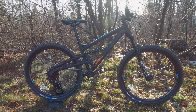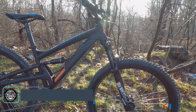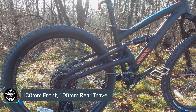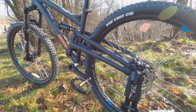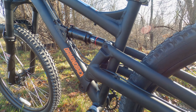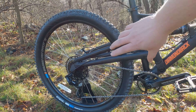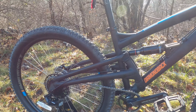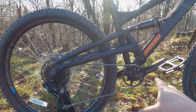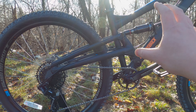How they achieve that on this bike is the ATROS frame is set up with 130 millimeters of travel up front, but it only runs 100 millimeters of travel in the rear. That four inches of suspension travel in the rear is done through a traditional high pivot, single pivot rear suspension, meaning the whole rear swing arm rotates on a single pivot. By having that pivot above and in front of the bottom bracket, this is going to have pretty decent climbing capability for an inexpensive full suspension.